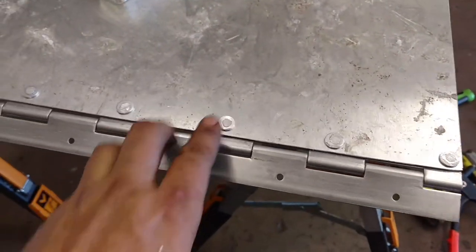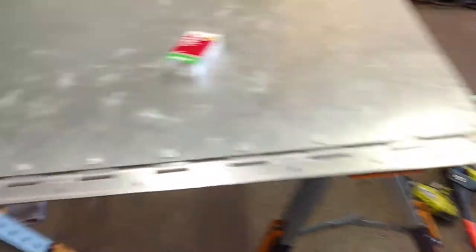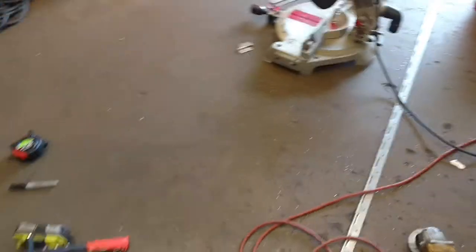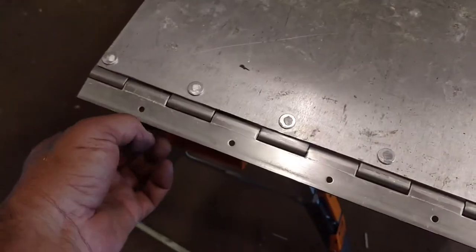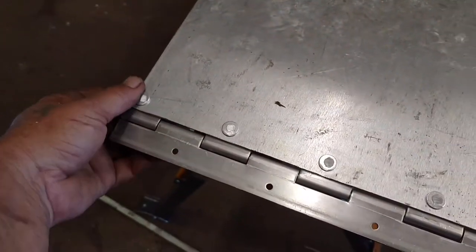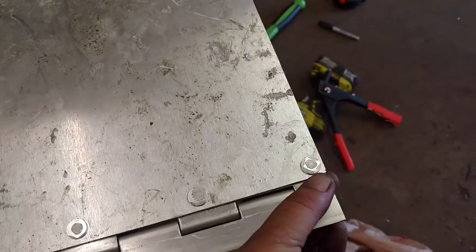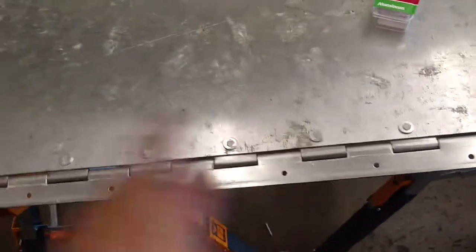So definitely want to have that as flat as possible. The washers may have pulled it out a little more, so the little nub that was sticking out I basically sanded that down. We'll see how it fits when I get it over there. I'm going to do the same thing to the other one. Got another piano hinge here that I need to cut a little bit off of. I made sure these holes that attach to the bus don't need to be right at the edge — where the door is, to keep it from warping, bending, or twisting. I made sure to cut a little piece off the end, then measure it and split the difference between the two.